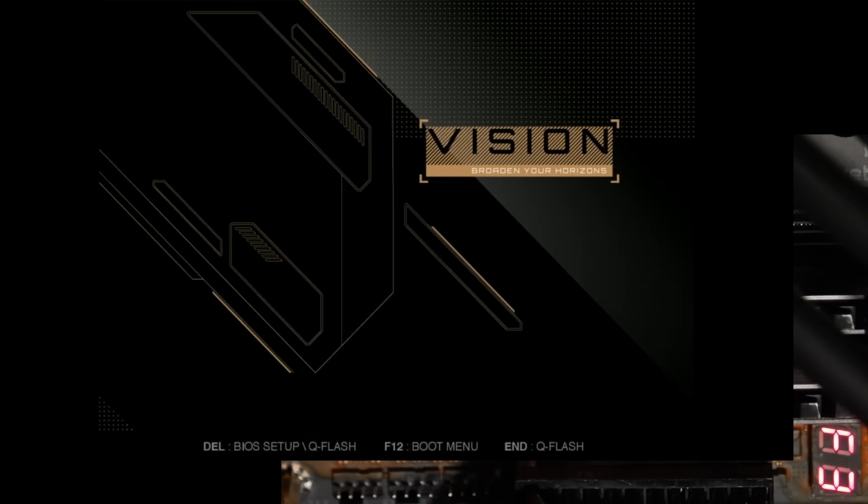Then I tried the Gigabyte A520MH, which I got to 106, but I don't know if it had the custom P-states thing. But yeah, I got to 106. That didn't actually, I basically didn't manage to get past the stock performance of the CPU. And it looks like we're lucky because I think it trained and it didn't clear the BIOS. Good. Okay. So we might have a second chance at getting into Windows.